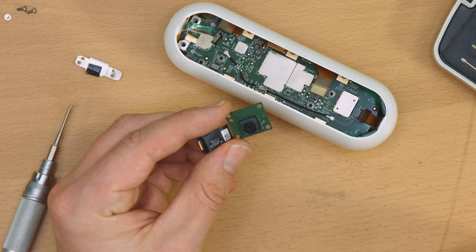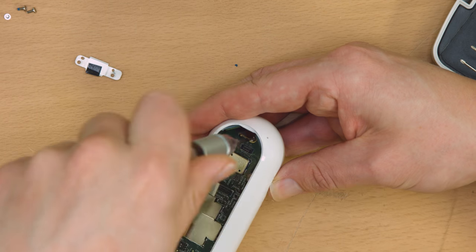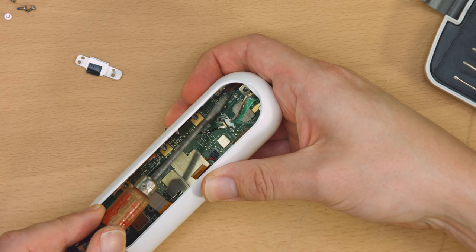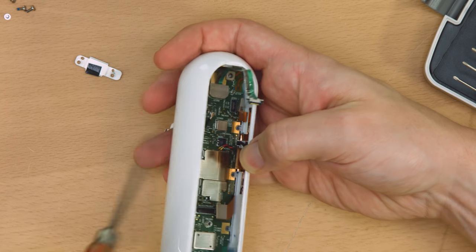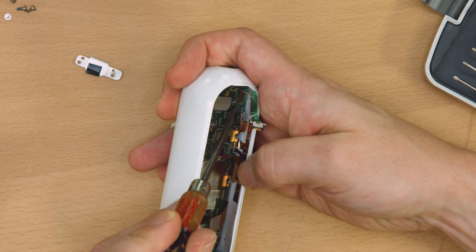The camera PCB is pretty unremarkable, sadly. There were only two apparent screws holding this layer down, as well as a couple of other connectors. Here at the end are two UFL-style connectors, usually used for RF applications. I'm guessing either both are for Wi-Fi antennae, or one is Wi-Fi and the other is Bluetooth.